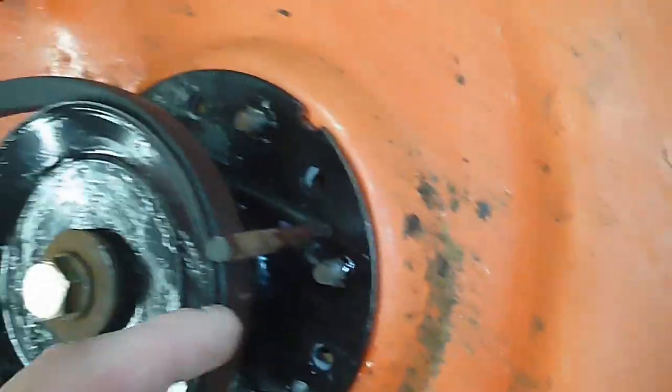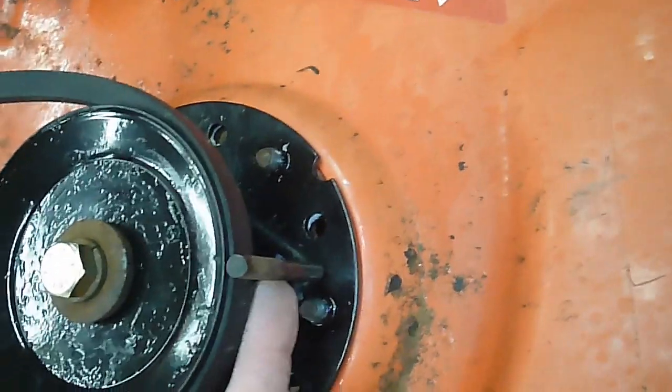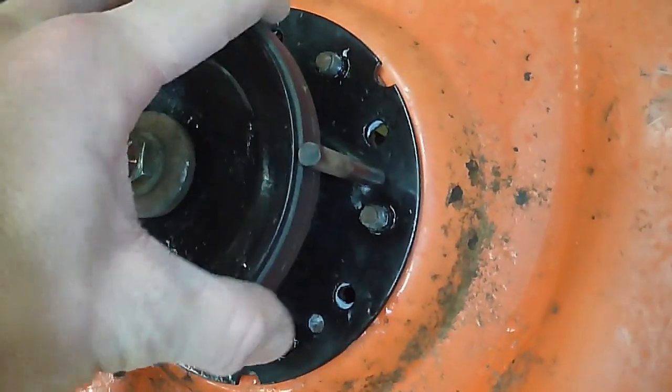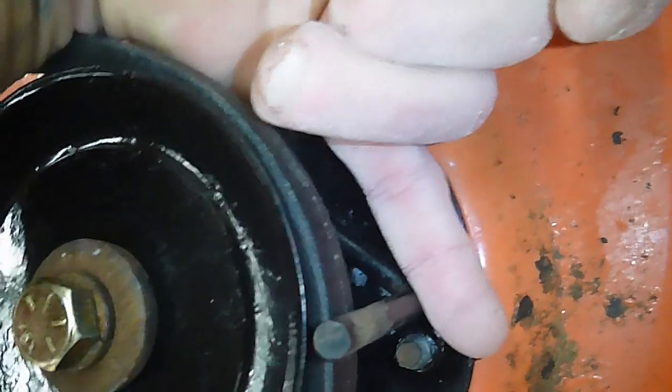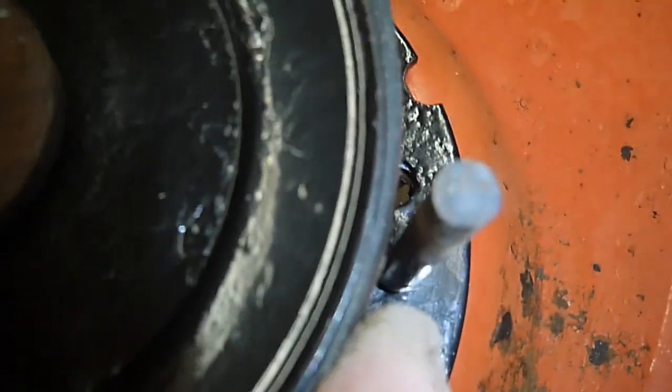They should fall in line with the direction of rotation, so that if it was to contact the pulley it wouldn't go straight up against it. So this way, if the pulley spins this way, and the belt guard is coming this direction, if it hit, it would just rub. It wouldn't actually catch on it, and that just keeps the belt at the outer extreme from jumping off. And there should be about a little under half an inch, about 3/8 of an inch gap right there.